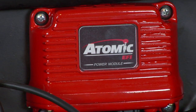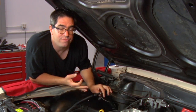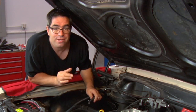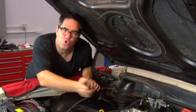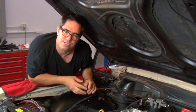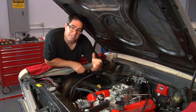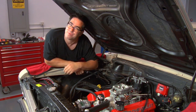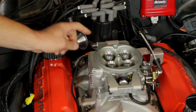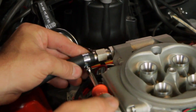Connecting the gas tank to the fuel injection unit is really easy. We've already drawn our 3/8 rubber fuel line from the back to the front of the car, avoiding pinch points and heat sources. It's worth reiterating how nice it is not to have a return line. With return lines, gasoline makes a continuous circuit from front to back, picks up heat in the engine compartment, and fuel temperature can increase by 50 degrees — leading to evaporation. The MSD throttle body comes with an AN dash-six fitting, but we're using the included barbed fitting with a rubber line and an EFI-specific clamp.